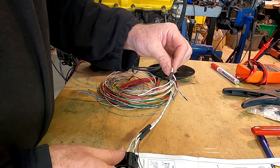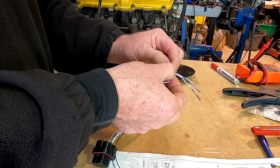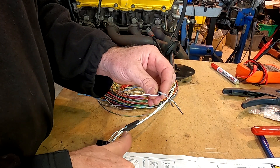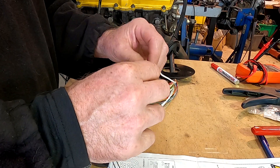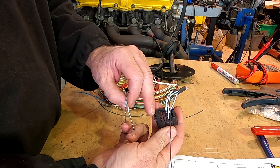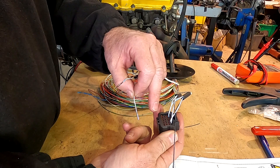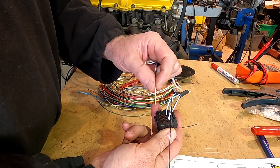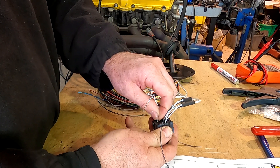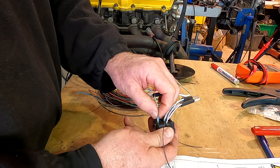Here is my wire. The earth and the shield are joined up in here — it's going to be joined to the signal ground, which can be pin 14, 15, or 16. I'm going to count the pins: number 20 is at the bottom left, so 21 is the next one in. The orange trace — knock number one — pops all the way in, and blue trace is number two, the right-hand.